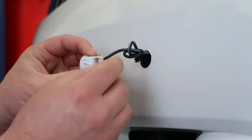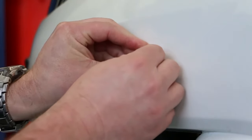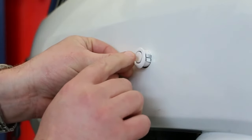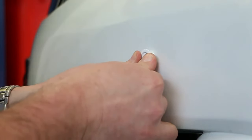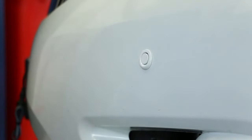The sensor must be a slightly loose fit, as pressure will cause false alerts. Must not push the sensors in the center, only via the outer rim. Sensors must not angle down, they must be on a horizontal plane or angled slightly up. This will avoid false alerting.